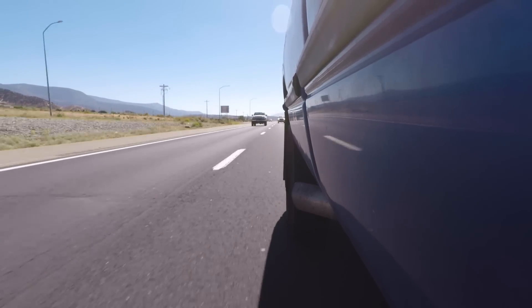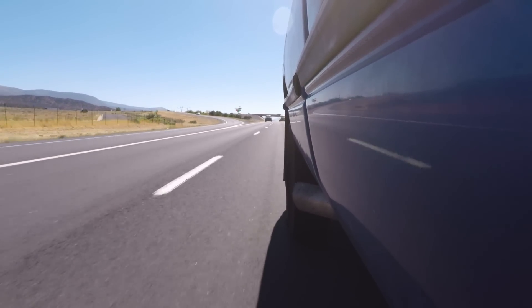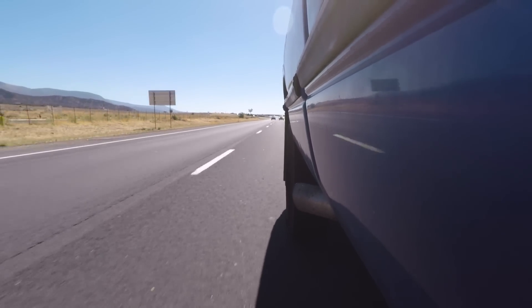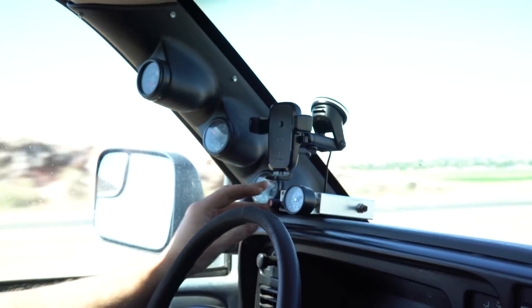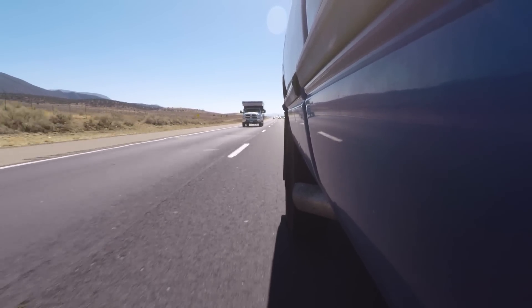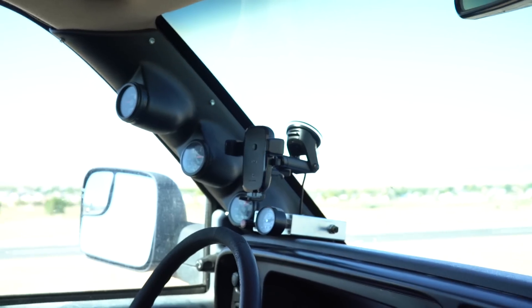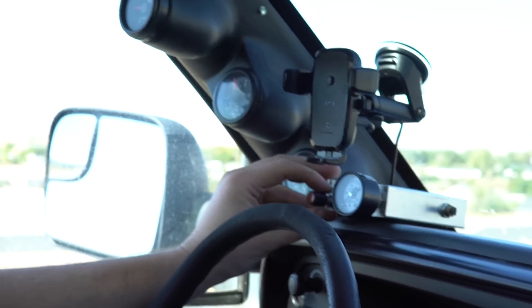Still 1,500 degrees. Now we're down to 7 psi — about 1,100 degrees is all it had. So we'll turn it back up a little bit to try to hit our target of 1,200. Now the AFC is seeing 10 pounds of boost and it looks like 1,250 is all she had. If we wanted to get it back down to a more stock 900 degrees — now it's seeing about 5 pounds of boost — 850 degrees.